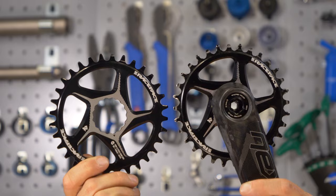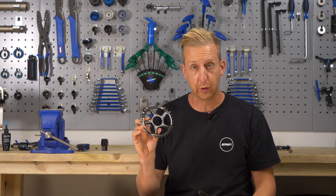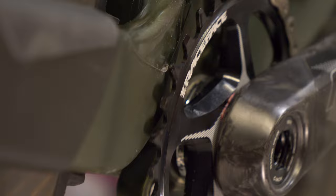A little bit about chainrings themselves and the way that you fit them onto the cranks. In this case, it's like for like — the one on here actually just got damaged in a crash, so we're literally replacing it with an identical one, same size. Now, this is an important thing: if you're not replacing yours with the same size — if you're, for example, going for a bigger size — make sure there's enough clearance on your frame. Most modern one-by systems like this will have clearance for up to a 34 tooth. It is possible to fit larger chainrings, but it does depend on the chainstay clearance on your bike and the Q factor as well. There are a lot of different things to take into account. Don't just go buying a 38 tooth, for example, and think it's going to fit on your bike if you've only got a few millimeters of clearance with a 32 on there.